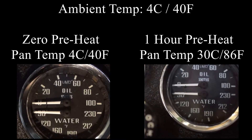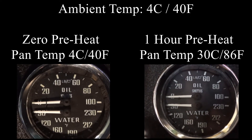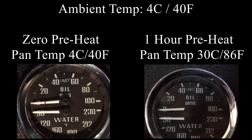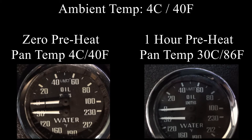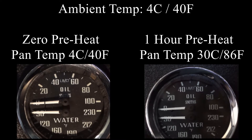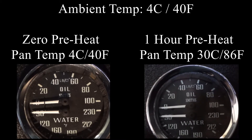I've synchronized two videos so that the car starts at the same time in each. When I performed both cold starts, I used the same amount of choke — running the car first at 2000 rpm for a few moments, then backing off to 1500 rpm, and after approximately one minute decreasing to 1000 rpm. This way, engine rpm is taken out of the equation as much as possible to get a true comparison between the pre-warmed engine oil and the cold-soaked oil.